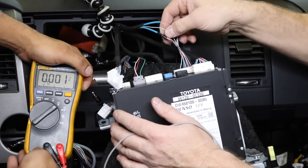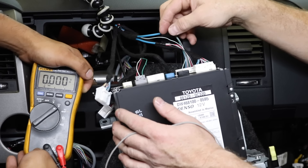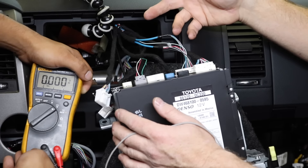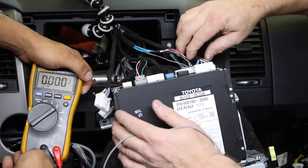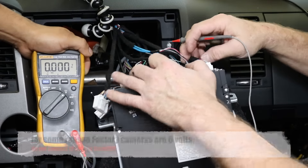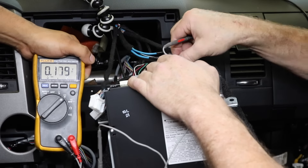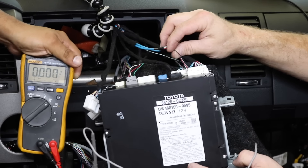Now what we need to do is find the camera. In this particular harness, it's got two bundles that are signal and this little green wire here. For a camera, you basically have four wires: signal positive and negative, and power positive and negative. Looking at these two, they both have four wires, so that's not going to help us. You just pick a side and go — in this case we're going to pick this group here. What you're going to want to look for first is power, and it's typically going to be 6 volts. We'll go ahead and probe the black wire here and we get 6 volts, so we know that's going to be our power — the black wire — this is the 6-volt supply to the camera. So we're going to use our step-down converter from 12 to 6 volts to power up the camera.